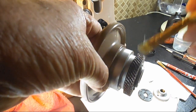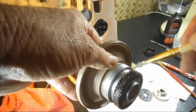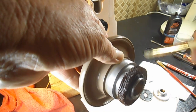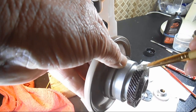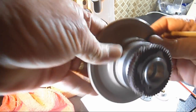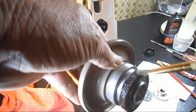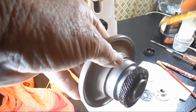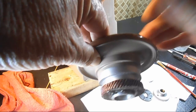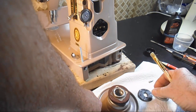I'm looking for anything that's not a little bit shiny with some grease. I've certainly opened up my share of vintage machines and found grease all over the place — at the top of a motor, the pinion gear, the hand wheel, all different kinds of lubricants. Like many people who work on sewing machines, I really like the Tri-Flow. It sticks to the gears real well, doesn't get thrown off as much, and it's got a real high temperature rating. I'm just real satisfied with it. I think that's got a nice coating now, so I'm going to call it a day with the grease — there's no other grease to go on up here in this area.